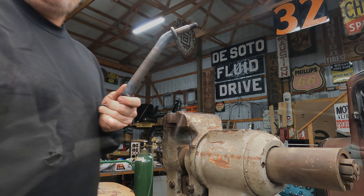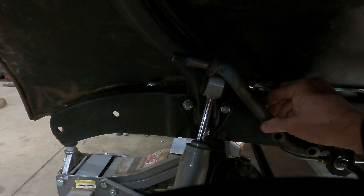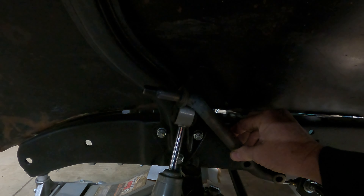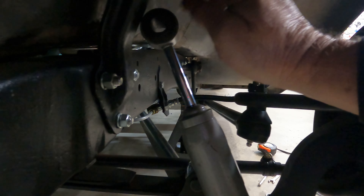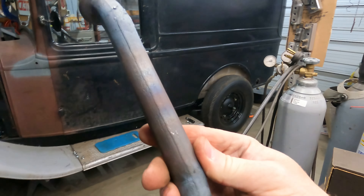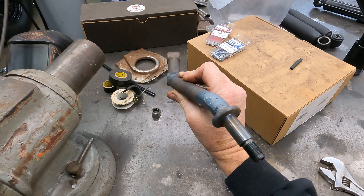Let's see what that looks like now. That's actually not too bad because I can cut a section out of there and turn it a little bit to where it fits. If you look here at this line - it will be if I make it like that - it is parallel with the frame rail. But when we come over here and look at this, we can see that it's not. So I need to twist it back in line with those two bolts back over there.